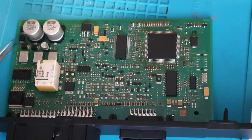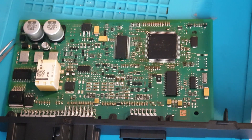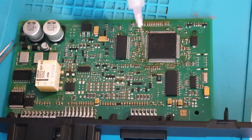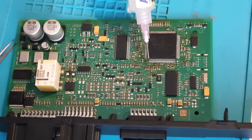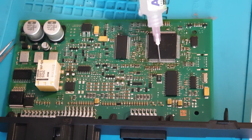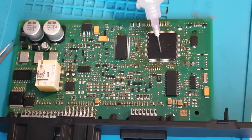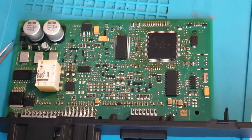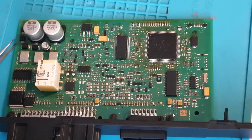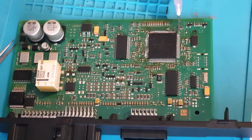I'm going to get straight into it. This is one I've already fixed — this is basically a CAS3 unit out of a Mini. This is the old unit, it's got some damage over here and under the relay. So what I did was I got another unit and swapped — this is the MCU off the new unit. Obviously the original chip from here that has got all the immobilizer details and key information, I've taken off this board and put it on the new one already. So this is basically just a parts board — I put this chip on here just for purposes of this video, so it's going to come off easier than it normally would.